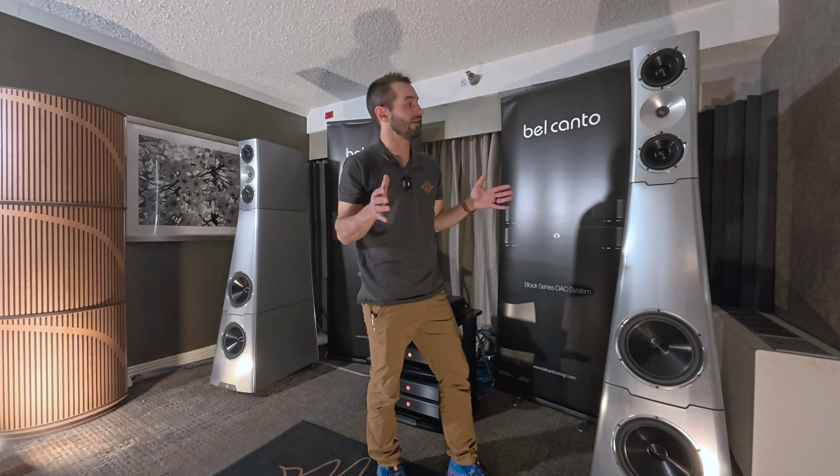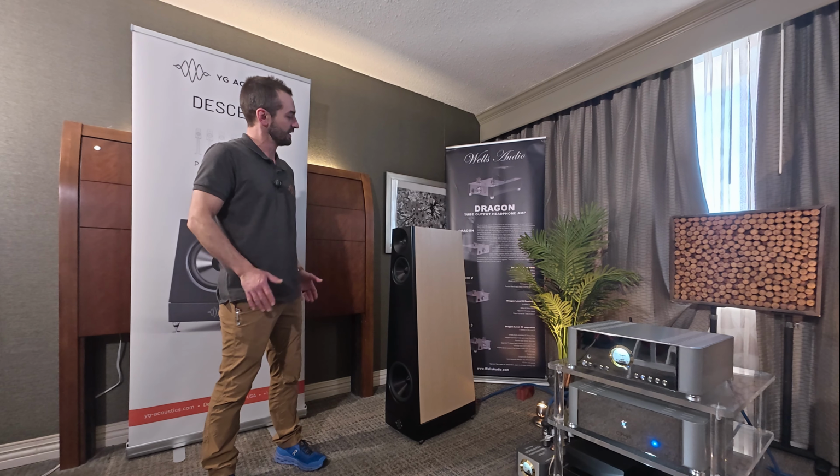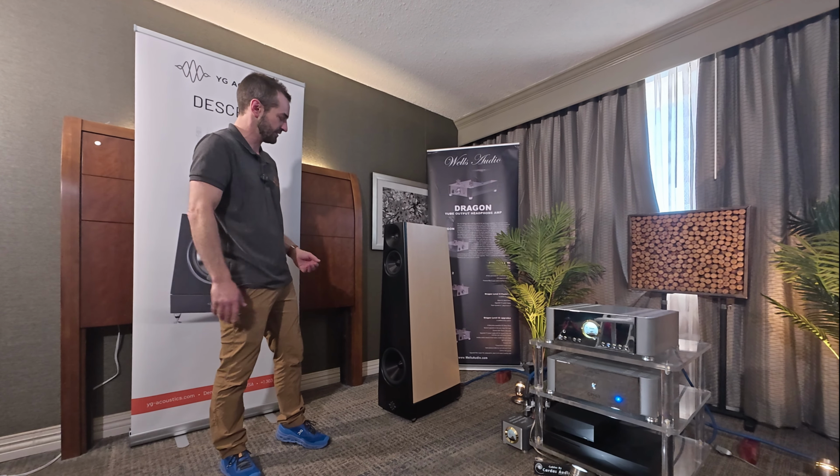And our speakers in this room are called Summit. They are from our Peaks series. It's a painstaking effort in trying to make wood fibers operate and behave as close to our aluminum enclosures as possible. We use extraordinarily dense material that's made from very small fibers with a huge resin content that's been squashed by hydraulic presses and then curved and kerfed internally and braced and braced and braced.